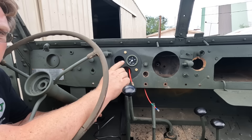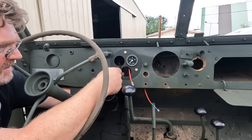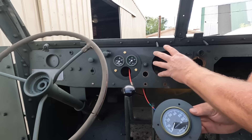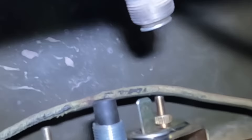I've got the oil pressure gauge hooked up to the original line. Now I've got the mechanical coolant temperature gauge — I've got to fish this whole wire all the way through. Mechanical gauges are nice because they're reliable and don't take a bunch of wiring, but they do require fishing the line through. I made a second plate for the other gaping hole — same approach, fits over without damaging the dashboard. I also made a hole for the speedometer that came with my gauge kit, though the speedometer doesn't work and the cable's broken. It's just going to fill the hole in the dash for now.